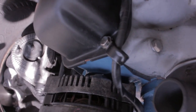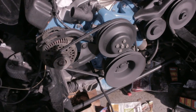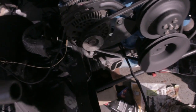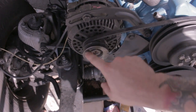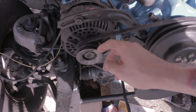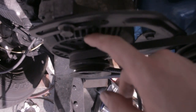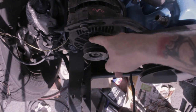The clearance is pretty tight — you can see right there between the head, so it's close. If it's not right, it won't fit. I went ahead and went to O'Reilly's, got a $5 belt to pop on there and see if it's lining up, and it's lining up fine. We did have to shim this pulley — this is the pulley off the original 1G alternator, because when you pull these from the junkyard they'll have a serpentine pulley which won't work. We popped the pulley on from the original alternator and without shimming it, it rubbed against the alternator. If it's rubbing at all, you cannot run it that way and you have to shim it. We just popped a washer in, shimmed it, and it's good to go.